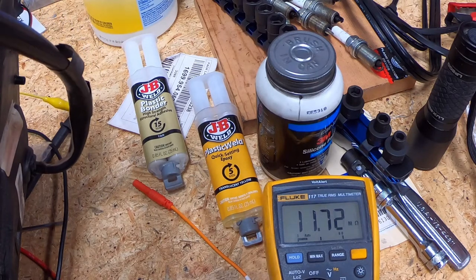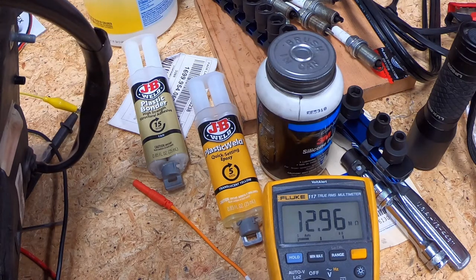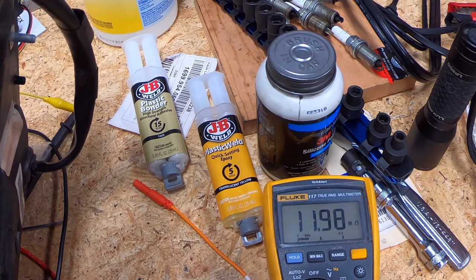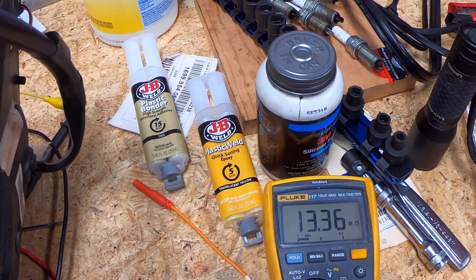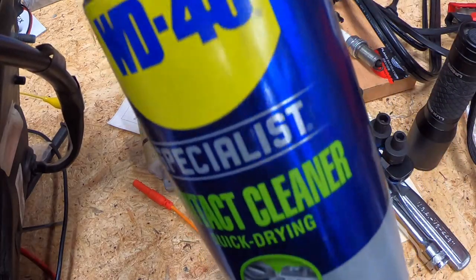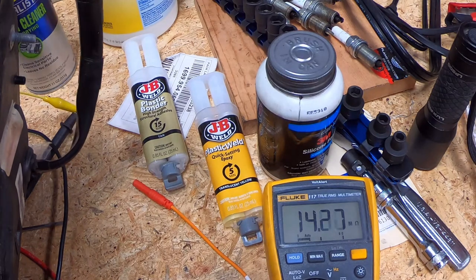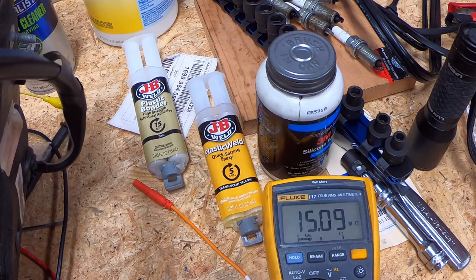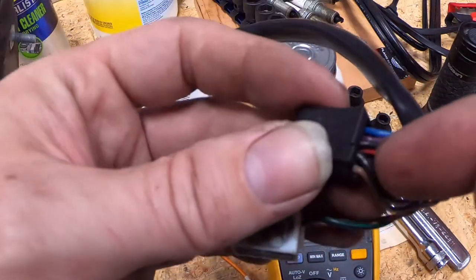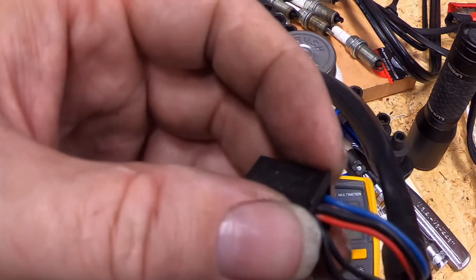I was trying to disassemble the connector and at one point got it down to zero, but now it's dancing between 12 and 20 megaohms. I'm going to spray it down with WD-40 contact cleaner to see if we can get this corrosion cleared out so the meter drops to zero and stays there. Then we'll reassemble the mirror. I'll work on this connector and bring you back.